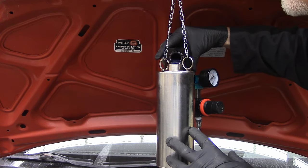The fuse box at the kick panel inside has a fuse puller. You can just jam it in there, pull out that fuse, and the engine runs out of fuel and quits. There it is, quitting. Still has the fans going, but it's still the dead of winter here. I went and put a thinner O-ring on there. There we are. That's happier.